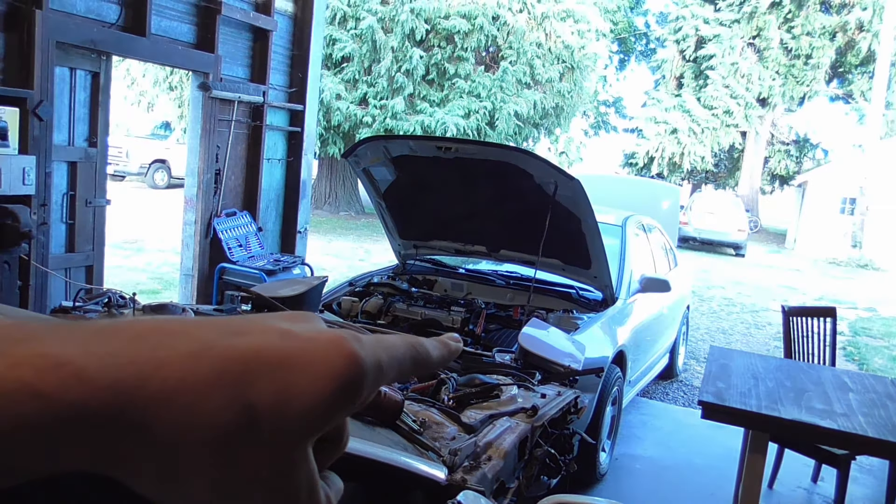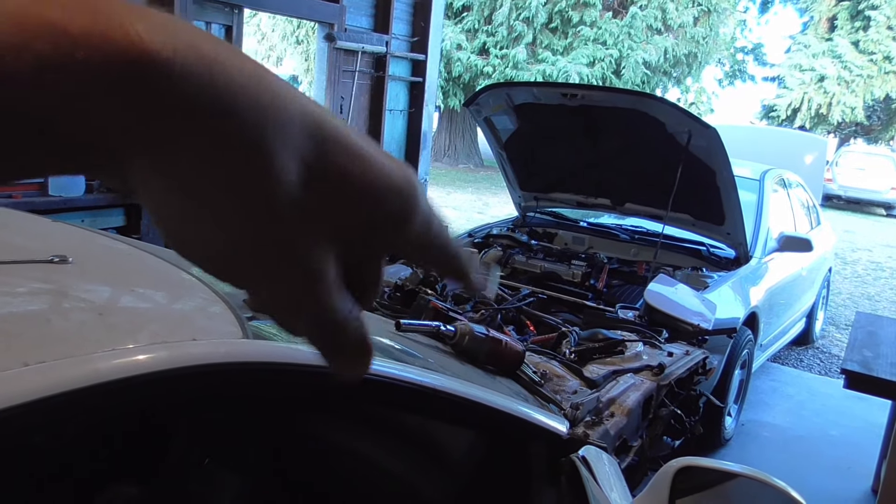Cars can be a pain sometimes. Here's the issue we ran into: first off, the cigarette lighters aren't getting any power, so I'm not sure what's going on. Second, I went and got a cigarette lighter to USB adapter, plugged it into the USB on the stereo system, and it immediately blew out the USB. I checked all the fuses under the dash and they all seem to be good — you can tell when the wire is connected. I checked the ones under the dash and the ones in the engine bay; I'm not sure if there's another one under the passenger-side footwell I need to check. I'm not entirely sure why it's not working because it is actually connected underneath the cigarette lighter itself. But the controller does turn on when I put it in my other Mitsubishi — I'm using that car's battery since there's no battery in the project car. It did flash on for a split second before it blew the USB adapter, so it works, I just can't fully show you yet.